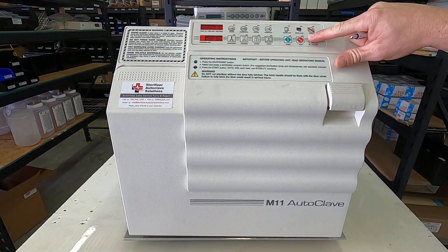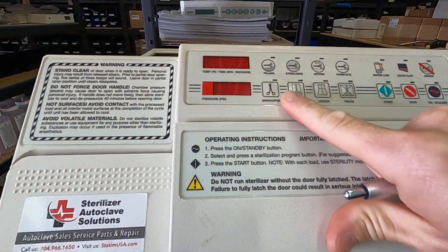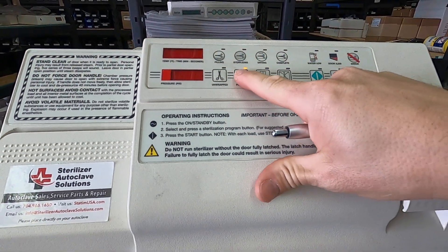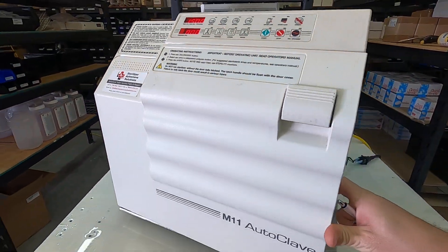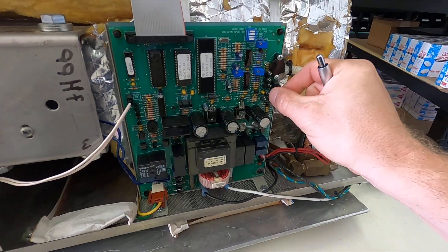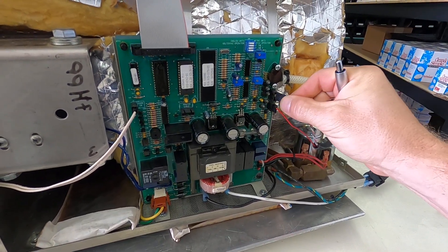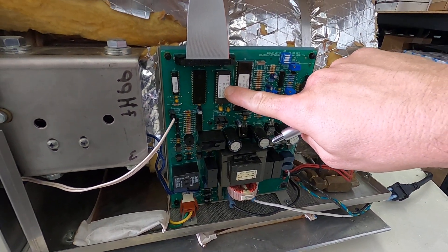Make sure you hit the on/standby button and check that the buttons come up on the screen. If you cannot get the screen to respond, there are only two possible causes: a bad temperature sensor, which you can try unplugging and replugging, or corrupted software.